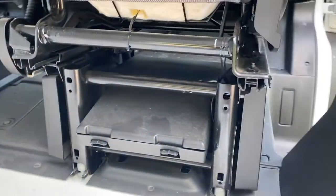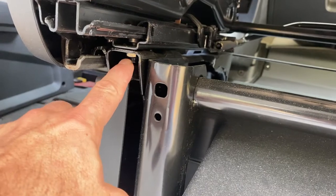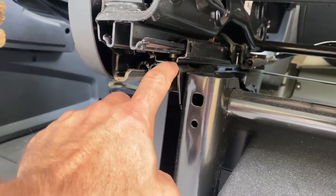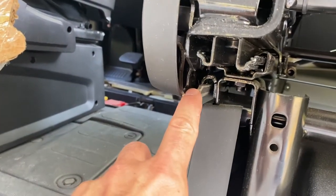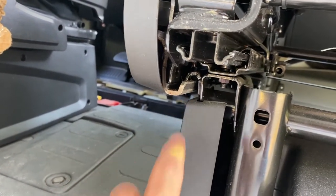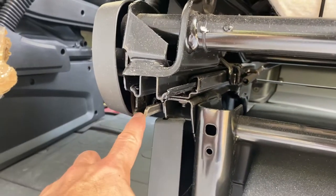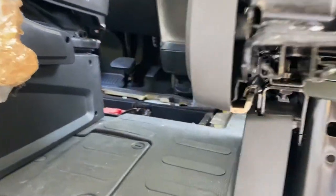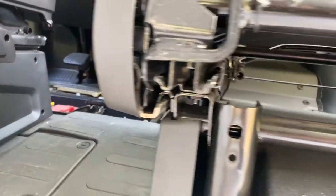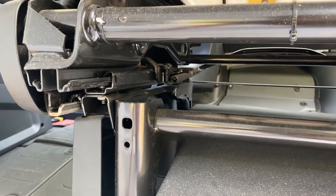If you look at the back of the seat, once you install the swivel it goes in here — you'll basically pull this out and the swivel goes in between these two points. There's a little piece of metal right here that gets in the way and that's why you need the spacer. If you have something to cut that piece away, and also cut the bottom of this plastic plate, you can actually install the seat swivels without the spacers.